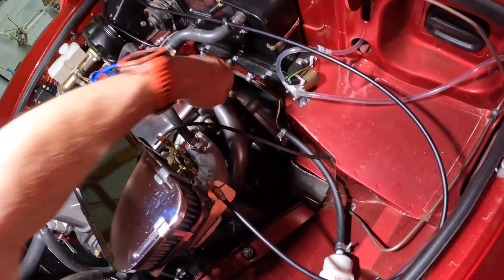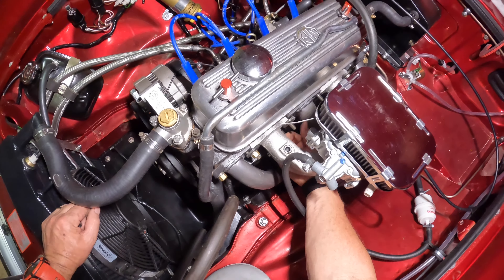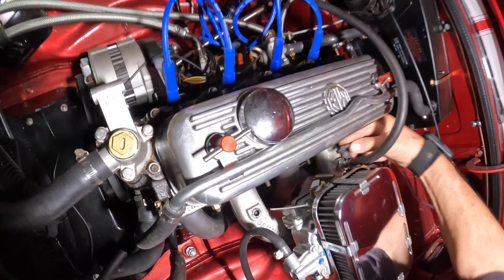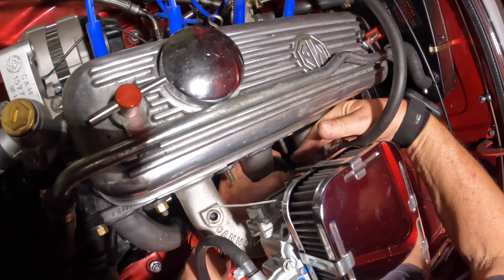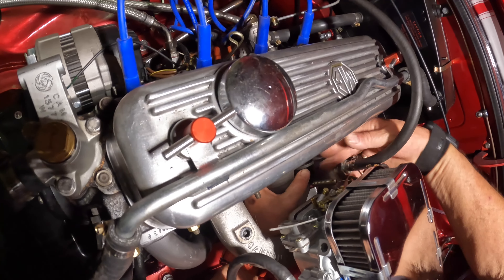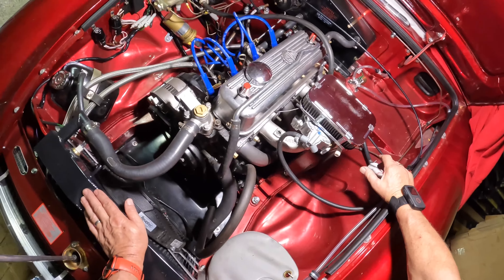So that works. I've done two of them now, this one and the other one are done. I just have to put the two little ones in. That makes it all work. I'd have done a better job if I'd put this on before I put the servo line on the vacuum. So they'll now tighten up nicely on there, the exhaust flange will stop leaking, and all the washers are now flush with the head.